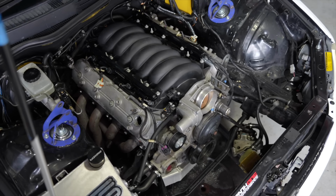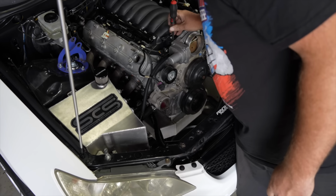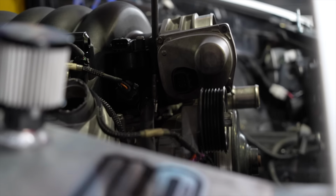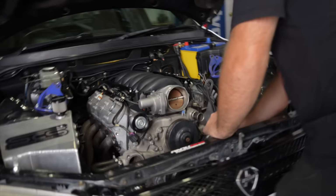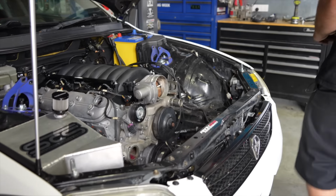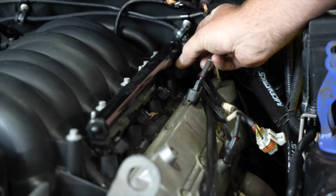F's in the comments. I'm going to keep that one dash six though, because it's coming out of just the valley plate. So trying to get a bigger breather line out of there is going to be all but impossible. So I'm just going to run what's there. I don't really think it's going to be an issue. If I can get both the rocker covers to dash 10, it's only going to be a supplementary breather anyway. So all of the loom is loose on that side, apart from the injectors. Injectors are loose.